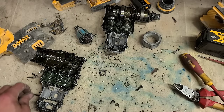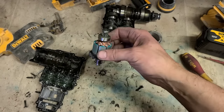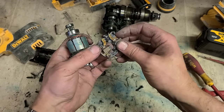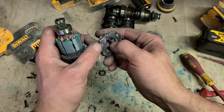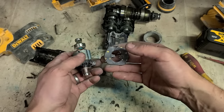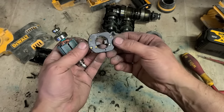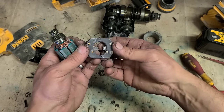Like I was saying, like the last one, the machine stopping, having to hit it to get it running. That could also be a problem when you're doing a machine, you get it in and it's working. Them brushes are gone. Probably stopped and hammered and kept dying on them when he was using it because they're actually cracked. Where they are, that been transported on here to me in the back of a van, rolling around, banging about inside that big black box, then brushes start to vibrate and the holders come down a little bit, make contact. Whenever I test the machine then, sounds perfect.